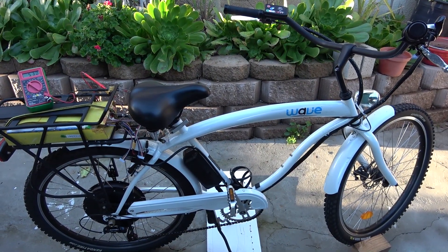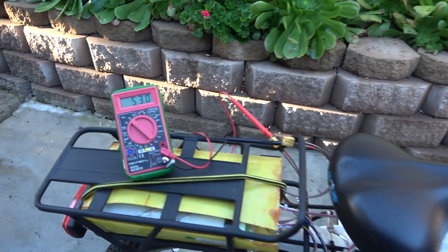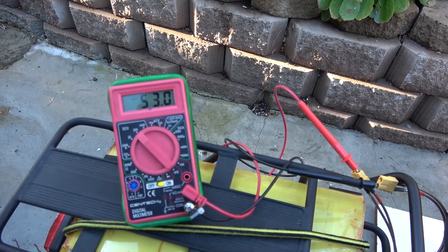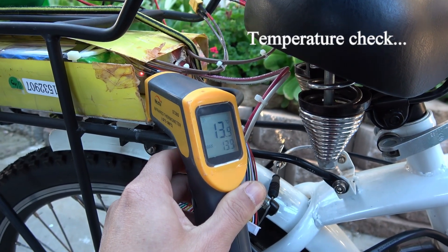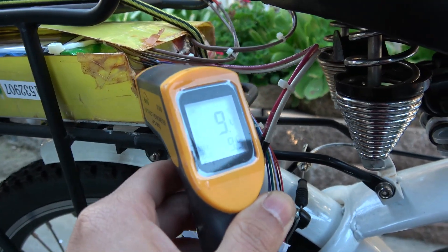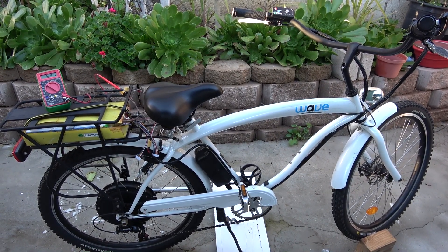The test drive was about 3 miles and I still had 4 bars. Battery voltage is 53 volts — I started at about 53.8 volts, so now at 53 that's about 90 to 95% full. That's pretty good. It's got good torque and good speed. Outside temperature is 14 degrees Celsius, ground temperature 9 degrees Celsius, and the battery stays cool. Next video I'll do a full range test to see how many miles the battery will give me.